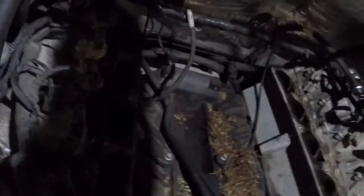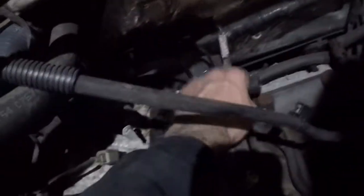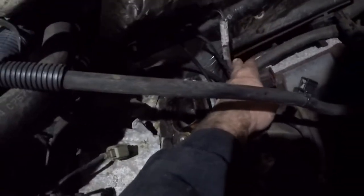You also have your vacuum hose that goes to your brake booster — it'll slide off if you're gentle. Whenever I put these back together, I always try to avoid running the wires back through the intake manifold runner control, because if you ever have to take the intake back off, it poses a problem. If you run them down and back a different way, you tend not to have an issue with them catching or rubbing anything. That plug there is for the intake manifold runner control.